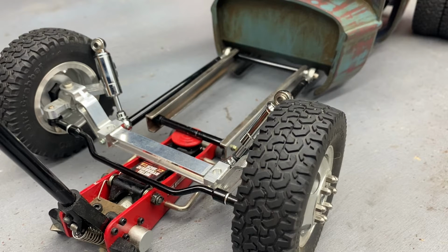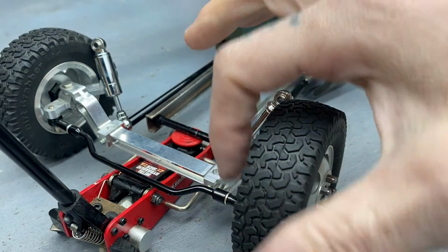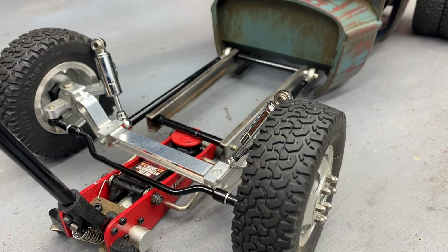So we've got the front axle here. There's still a lot of stuff to sort out. I don't have the right hubs in the axle. These tires will not spin right now because the steering link is hitting the inside of the wheel, because these are 155s. But I do like the height of this tire and wheel combo. Not 100% sure we'll stay with this, with the duals and everything, but we know the height goes with the body, and it goes with the height of the body off the ground. The ground clearance and everything is pretty well set now. So if we do switch to another tire later, it will be around about this same height, so that we can build suspension off of.